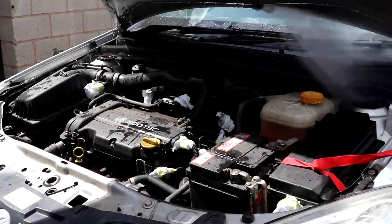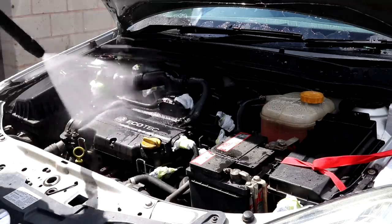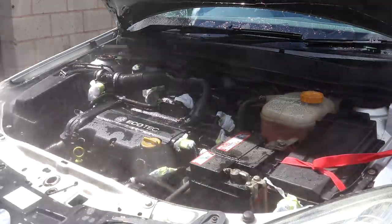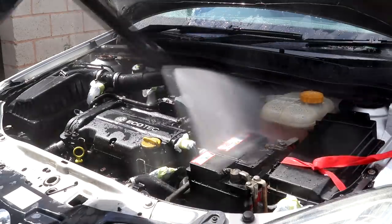When rinsing the engine bay, never allow the stream of water to be forced into any of the areas and always keep the jet stream at a respectable distance from the bay. Problems will occur when you start forcing the high stream of water into some of those mechanical components, rubbers and seals, so quite simply, keep your pressure washer at a distance.